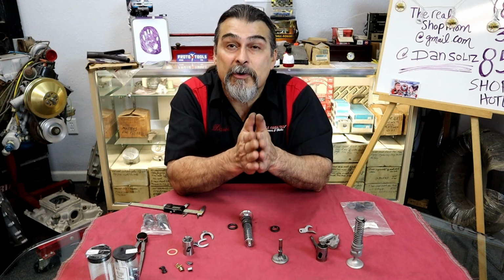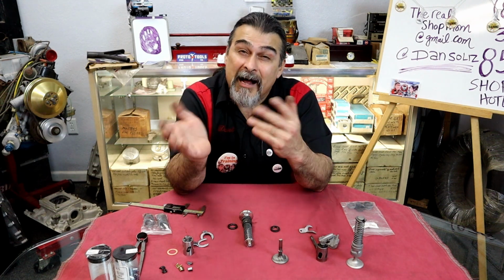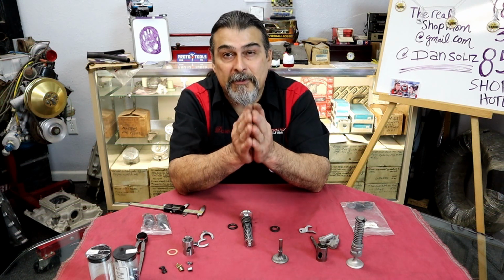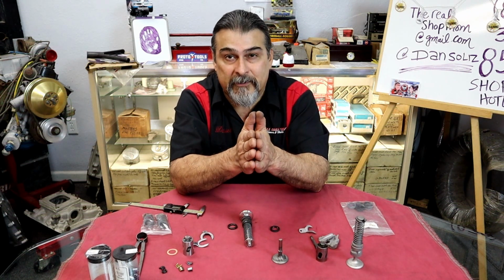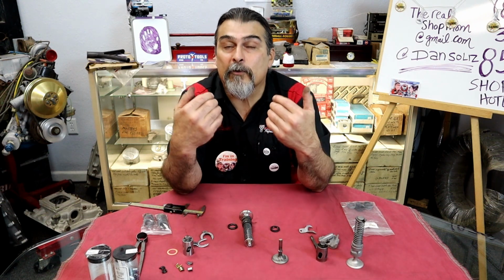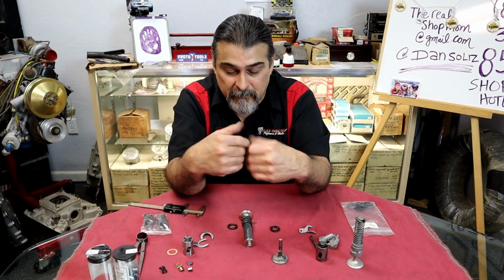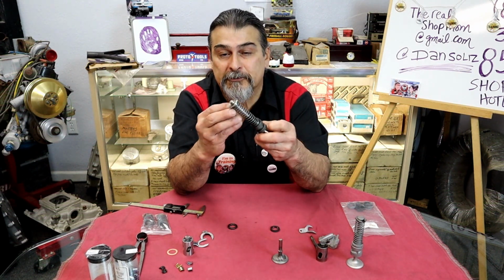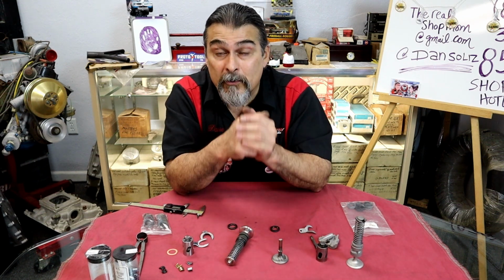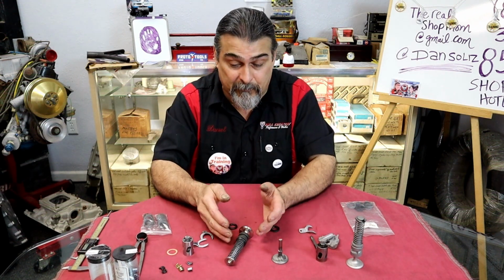Brings up a good question. How much spring pressure do we want on a flathead Ford? You want about 85 pounds on a performance cam. I'll do a little less, 70 pounds. There's no need to put too much spring pressure. There's no reason for it. All we're doing is making less horsepower and wearing the parts more than we need to. There's no more zinc and phosphorus in our oils, and more spring pressure just puts more of a load on the lifter and the cam.